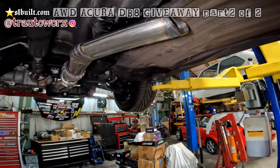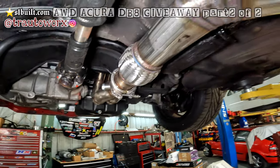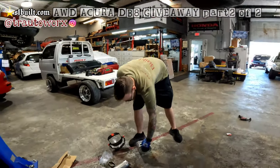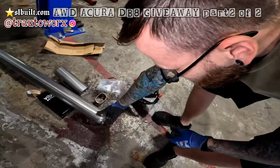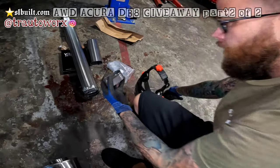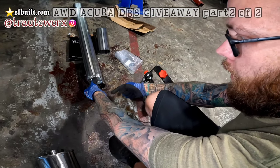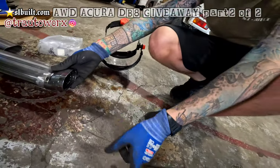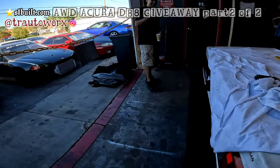Check it out, guys, right here. He put the exhaust up. Looking nice. Look at them pipes. It's gonna come out here, as he said. It's gonna come straight back. There goes the piece. So these are like the horizontal transitions. As you can see, it's kind of lifting up, so it's gonna sit under there. It's gonna lift it up a little bit, and then from there, it's gonna start dumping it back so that it straightens it out. And then we're gonna transition it from an oval to a 3-inch so we can go directly into the resonator from there.